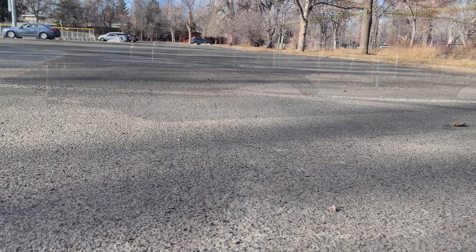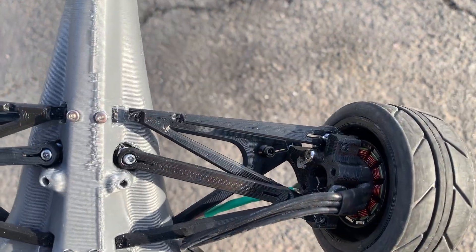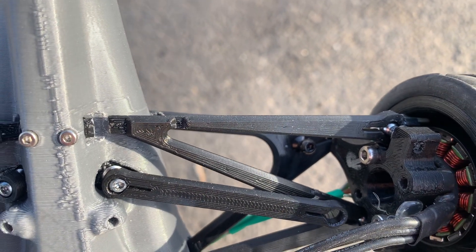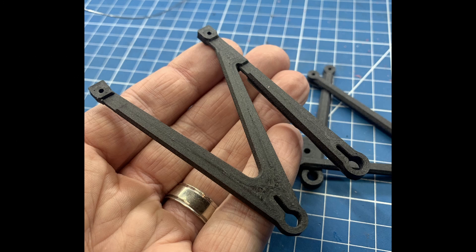Things were actually going so well that I decided to test the flexor joint strength. In the parking lot where I was testing, there was a bicycle jump, and I took that car off the jump half a dozen times. The monocoque held up great — no issues there at all. But on the last jump, I caught a wheel and did a cartwheel, and ended up breaking one of the rear flexor joints. It was really because the car had no bump stops and no shock absorbers installed, which just allowed the wheel to bend at like a 90-degree angle to the entire car and snap the flexor joint.